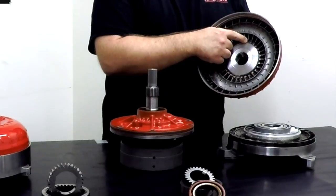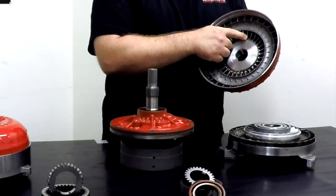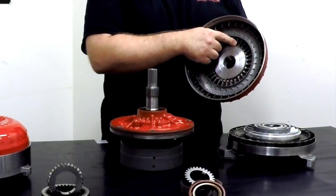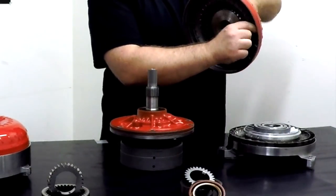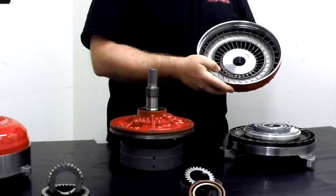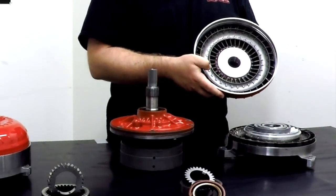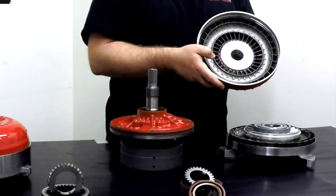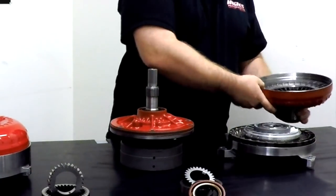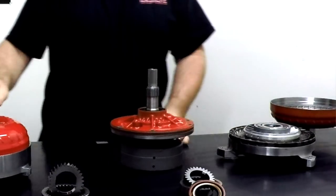It helps prevent damage to the fins, prevents them from folding over or tearing from the tremendous hydraulic forces generated inside the converter. We also go in and braze in the outer impeller fin here. You'll also hear a term called furnace brazing if you've been in the industry at all or an enthusiast. That's a little bit different. It's also a strength enhancing feature.